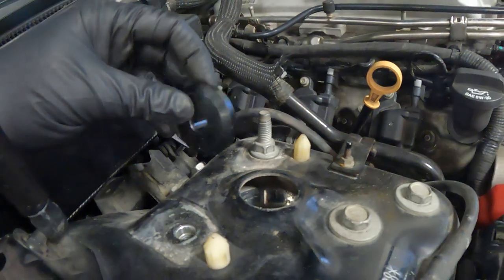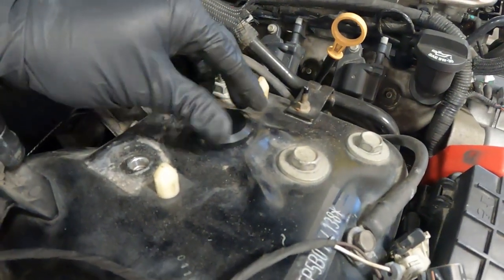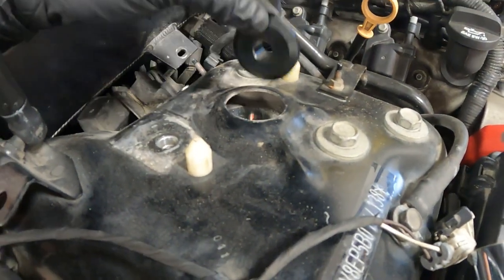All right, so if you're putting in these Viking coilovers, don't make the same mistake that I did. They gotta get bolted on before the A-arm bracket gets bolted to the car. So, that last little bit that you just saw, I'm gonna undo. I'll bolt these on to the A-arm bracket and reinstall that. So, yeah, enjoy the rewind and redo.